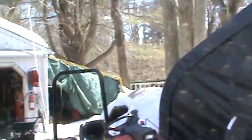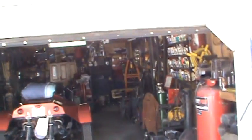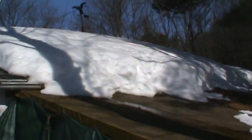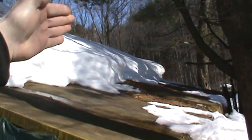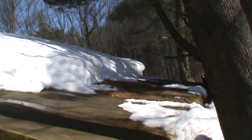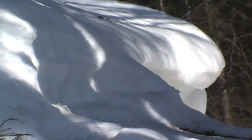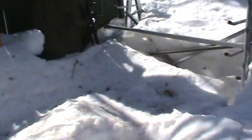So, I was having a problem with ice dams. And what happens is, in the garage, not in the house, if you heat the garage up, the heat goes to the attic. The ice and snow run down. Step up here. And as you can see, still about 3 feet of snow, probably in the highest center of that. So the water kind of comes down to where it's cold, freezes again. Now it has to go uphill and get over, and instead it'll run down the inside of the wall and blow out the walls. I don't know if you can see at the very end there. See if we can come in on that. So that causes water to run down inside the building. Not very good for it.